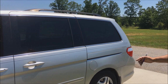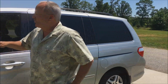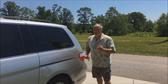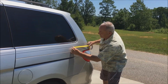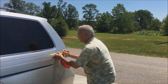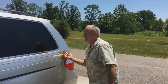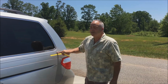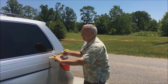It's basically done. The other videos talk about how to put in a small graphic that we carry in our name kits, or the logo. Basically, I don't think I included this in the previous videos, but really the easiest way to put in a name kit is to put a piece of masking tape underneath, and then put your graphic up, and then mark on the stripe where it's going to go, cut those pieces out, pull them out, and then you're ensured a straight line when you put the little name graphic decal on, because you're watching this gap underneath and making sure it's consistent with the bottom of the decal, pressing it across.